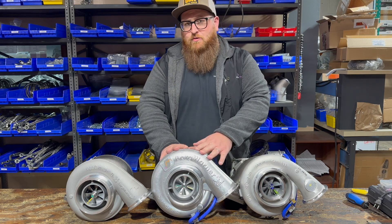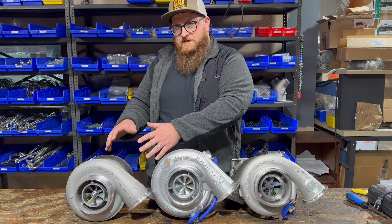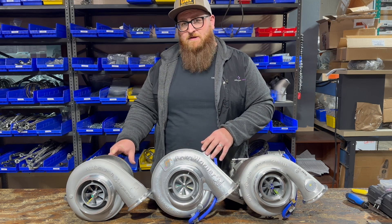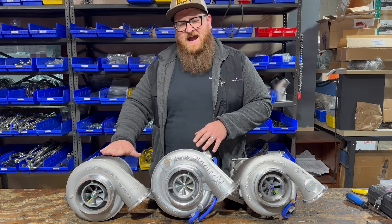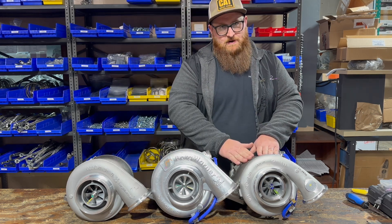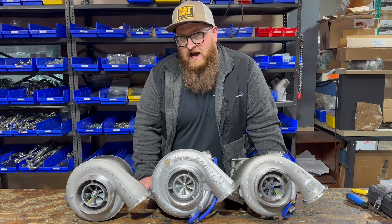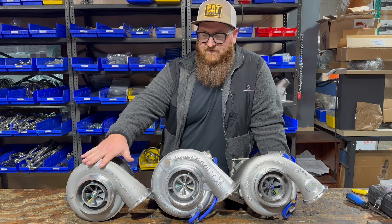The K31 spools up really good and guys love it, but they're always looking for more power so they end up going with the 1702. The problem with the 1702 is that the 12.7 liter just doesn't have the gusto to spin the larger 96 millimeter turbine wheel in that turbo. So the turbine sizes are: 96 millimeter on the S400, 84 millimeter on the K31, and 82 millimeter on the GT42 — a drastic difference. For a stock 12.7, the upgrade you'd really want is the Borg K31 over the 1702.